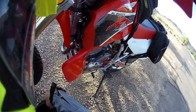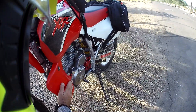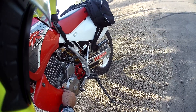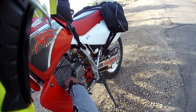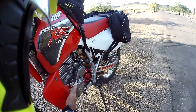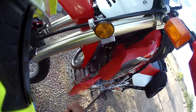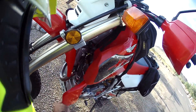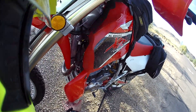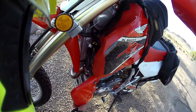I took it for a ride last night. The problem I had — and I know this looks kind of hokey — but I was thinking I'm just going to do like a little triangle-shaped plate, and it'll hold on that with a bolt going through. So I just have zip ties there. This is still under testing — this is my Skunk Works edition. When I was riding it yesterday, the bottom of the scoop, since there was no attaching points, it was flying out like this. It wasn't coming off, but it didn't look very reassuring.